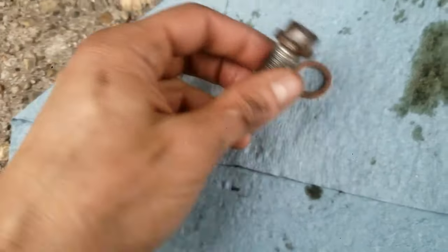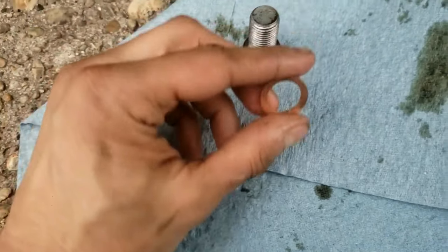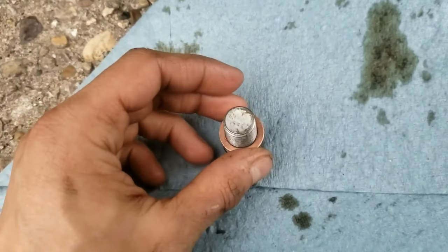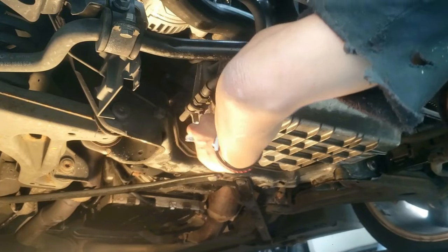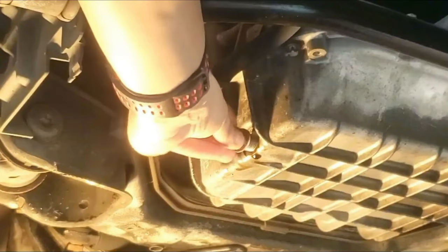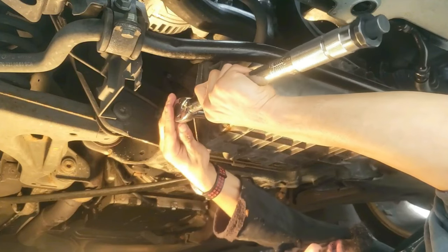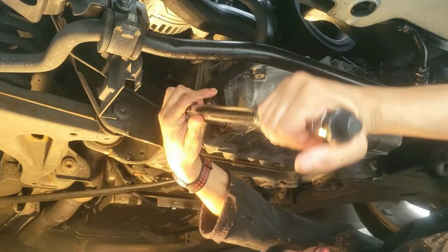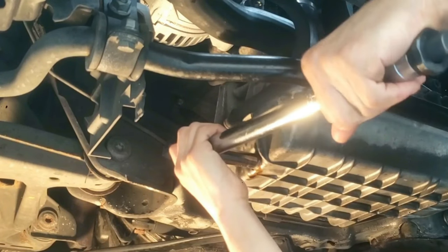Here's a helpful tip: the oil drain plug usually has a washer on it, and after a certain amount of time, it's best to just replace this. I'll put the parts and tools in the description below. Now to reinstall the drain plug — use a shop towel to wipe up as much oil as you can. Put the drain plug in with the new washer, start tightening it by hand first, then grab your torque wrench with a 13 millimeter socket and tighten it to 22 foot pounds.